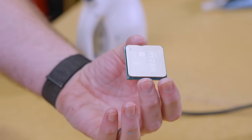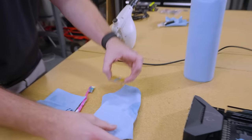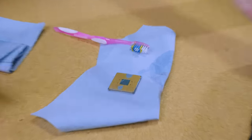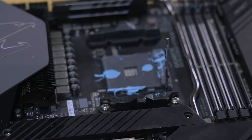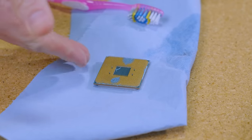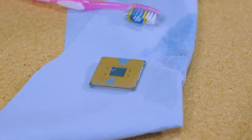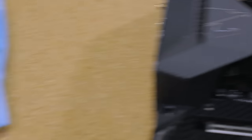This is what most people would need to deal with. Most people don't have to deal with getting it down inside there, but it has happened. I have absolutely seen people get it down inside the pins and ultimately down inside the socket. Now, this obviously applies to AMD CPUs because these are pin grid array — basically where the pins are on the CPU. It doesn't apply to AM5; this is AM4 and older. With Intel, cleaning the socket would be extremely difficult and very damaging, but for AMD we can at least get this done.